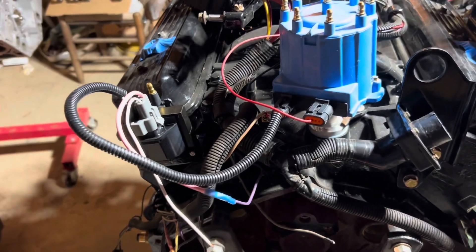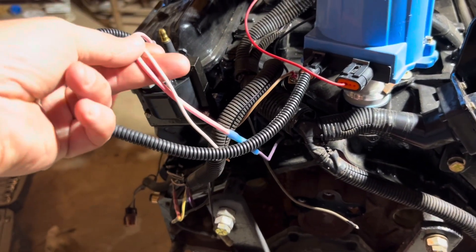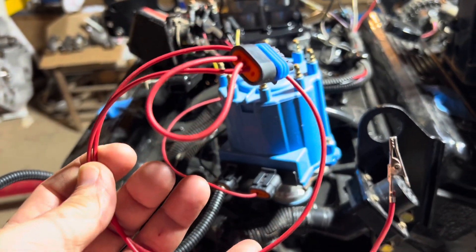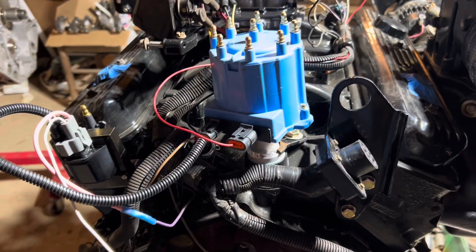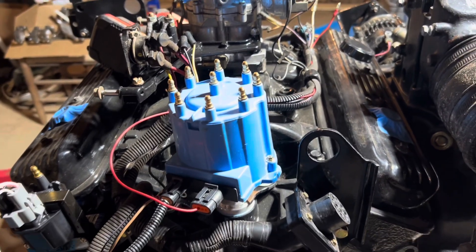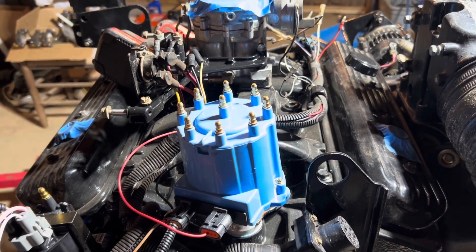To wrap up this video on the installation of a Delco EST kit and a Thunderbolt 5 harness: my kit comes with four harnesses. There's the coil power harness, the coil-to-distributor harness, the shift-kill harness which we've already discussed, and what's called a set timing harness — used only when setting timing, not when the engine's running on the water. I've got another video that shows how to use that. I'm going to do a separate video for the Thunderbolt 4 kits, as it's similar but I don't want to make this video longer than needed. Thanks for watching — subscribe to my channel if you find my videos helpful.